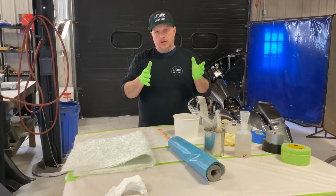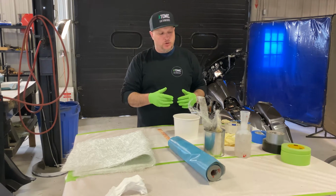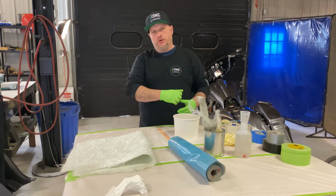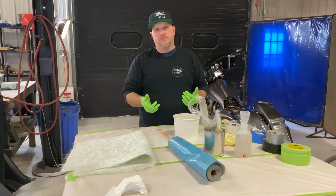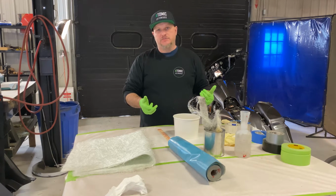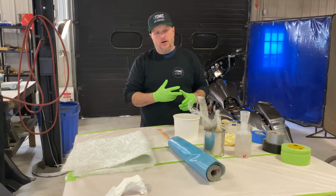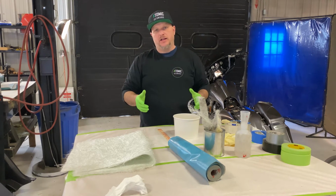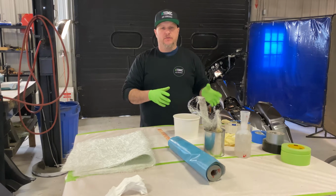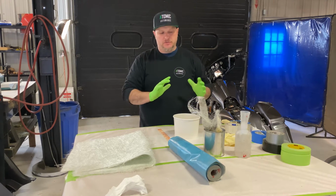Just one more additive protection so that nothing will drip through or run through any of the tapes. What's cool about the shipping tape is when you pull your fiberglass off of it, the bottom of the fiberglass doesn't sweat. We use a polyester resin for our seat pans because it never sees any UV. On our parts that we make for the motorcycles and for cars, we use a vinyl ester polyester blend just because the vinyl ester has some better properties. It's better for UV, it dries better, and you get less print through. It's just a whole different beast.